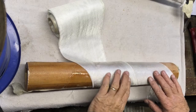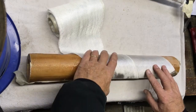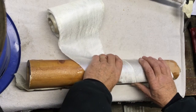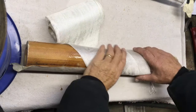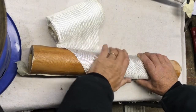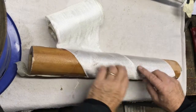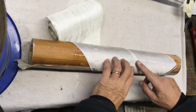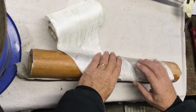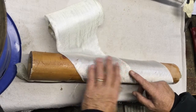Lastly let's look at the method where the cloth spirals around the cylindrical object. This is my favorite, and I think after you get used to its idiosyncrasies you'll find it's your favorite too. Its big advantage is how easy it is to put a slight tensional preload into the cloth as you wrap it, which avoids the problem with bubbles. I usually like to create about a half-inch overlap, though that'll change a little on a tapered mast because the cloth wants to migrate and change its pitch.